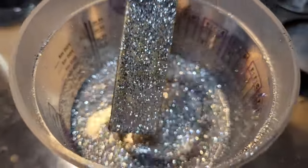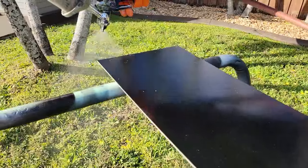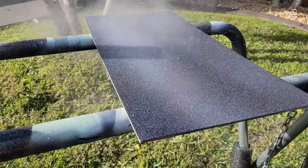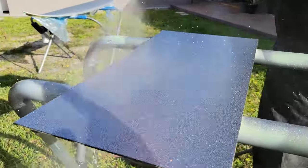This is pretty heavy now — watch when I pull out the stick. You see that? That is full coverage. That's exactly what you want and what you're looking for when using a black base as a foundation. Look at that full coverage stripe right there. On this panel we're going to do the same thing — six-inch fan, six-inch distance — and we're going to cross-hatch to get everything evened out. That is our 2.5 Tropical Glitz flake gun, and that is over black — exactly the outcome you're going to get mixing Platinum Plus with full coverage using our Tropical Glitz flake gun.